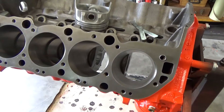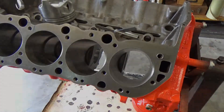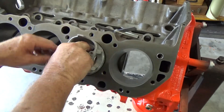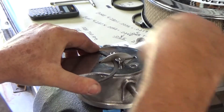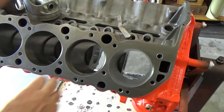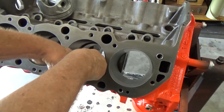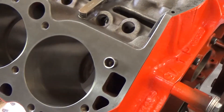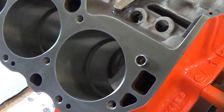I'll insert it in the cylinder — looks like I'm on maybe number five. At this point you're just doing the same thing and repeating the same process until you get the gap where you want it. The reason we do individual bores is because the bore finish can vary a slight amount, so when you gap a ring to a specific bore it's gapped exactly for that hole. A good way to keep track is to just leave them in the bore after gapping. When you assemble rod and piston number one, go to bore number one, pull out the rings, and install them on that piston.